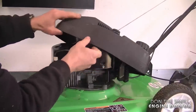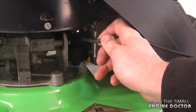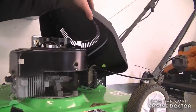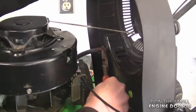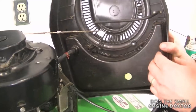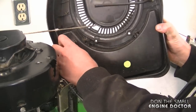Be careful because the fuel line and the primer lines are still hooked up to the carburetor. I'm going to disconnect the primer line, which is the smaller line of the two — it's just hooked in at the carburetor and you can usually just pull it by hand and it will come off. Now if I lift the cover you're going to see the fuel line on the other side. I'm going to loosen the fuel clamp and remove the fuel line from the gas tank. You can also empty out your fuel tank before you do this job. I'm going to keep the fuel tank tilted so the fuel doesn't leak out of the connector, then just pull off the fuel line.